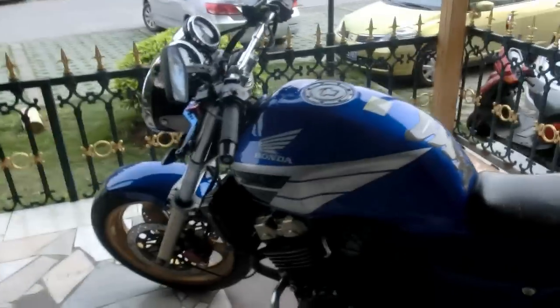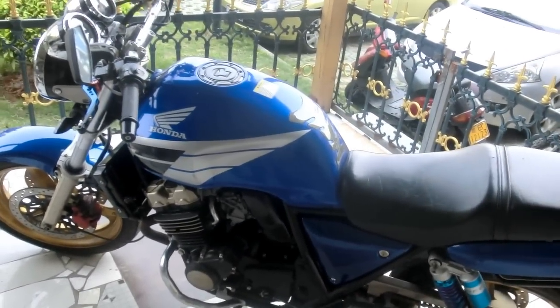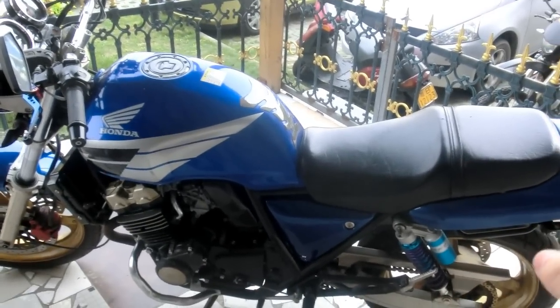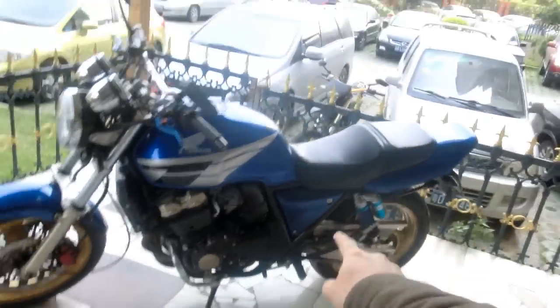I do plan to replace it. Because it's not really charging enough to keep the engine running, occasionally it'll cut out. When I say cut out, it loses all power. It can still idle along, but you can't accelerate. And that is due to a little part that's damaged.